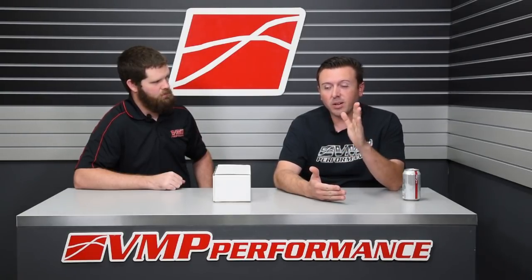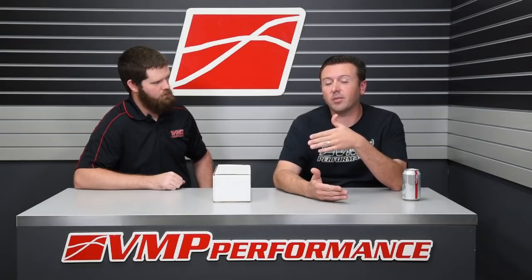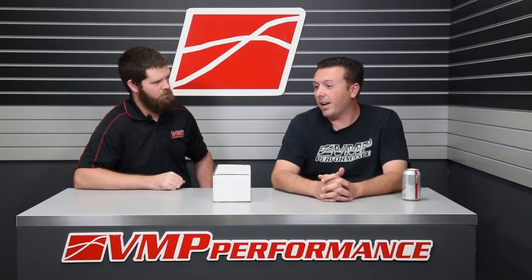The problem is that the trucks use a Super 8.8, and the placement of the ring gear is different than the old 8.8. So we're using the 15-up Mustang diff, because it has the right offset for the ring gear. So you don't have the full force of the aftermarket available. I think there's a 15-up Wavetrac, which is like $1,000. And other than that, I don't know what else there is. Yeah, that sucks. But luckily, your electronic locker has been working good. Yeah, so far so good.